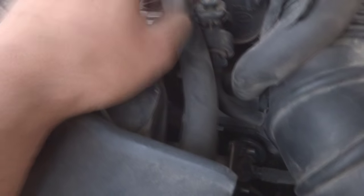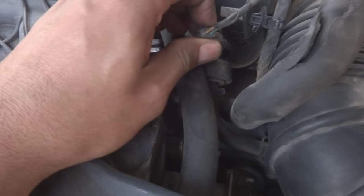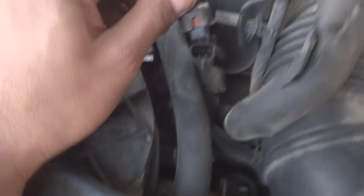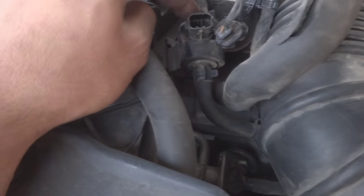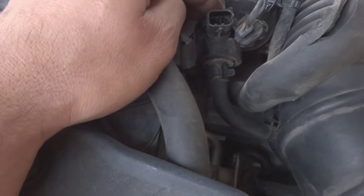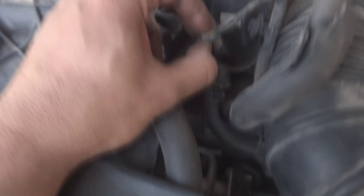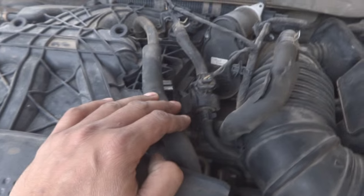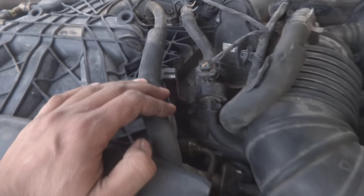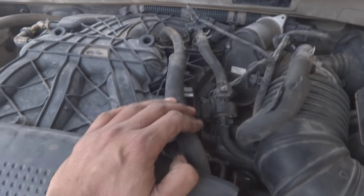The sound which you can hear is from here. These are the devices for the EVAP system. As you can see, the EVAP system is making noise. I removed the plug and there is no noise. These normally go bad, and even though I tried many devices on cars, they always go bad and make a clicking noise. But it's acceptable to the owner. Sometimes it's doing it, sometimes it's not. So it's okay. This is common for Chevy, Kia and Hyundai, or whatever brand.